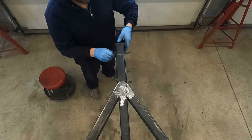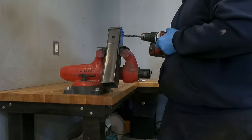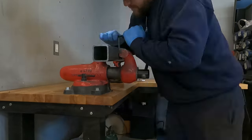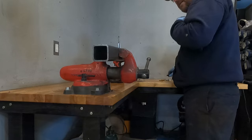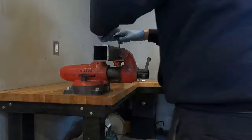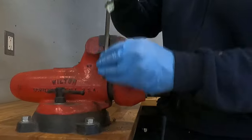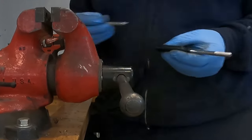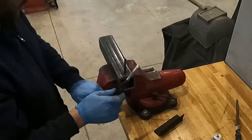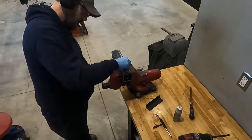Here I am mocking it up to see what everything would look like before I get it permanently attached. To stop the rattle of the hitch bouncing up and down inside of the receiver, I thought a simple solution would be to drill and tap a hole to allow a bolt to tighten the two together. However, that was before I realized my tap and die set is on its last leg. After about 20 minutes of hand filing the jaws, I was able to reassemble the tap wrench, put the receiver back into the vise, and then finally just simply tap the hole. After the hole is tapped, I was able to install the anti-rattle bolt.